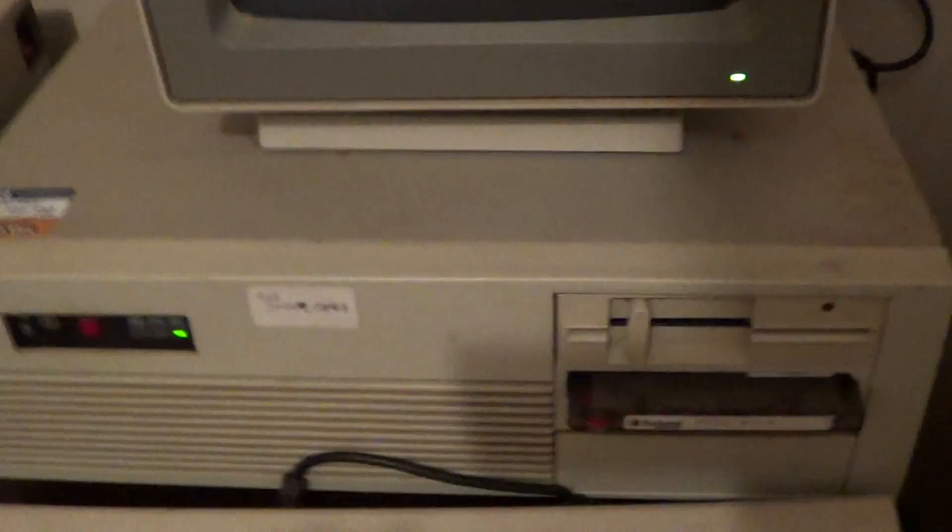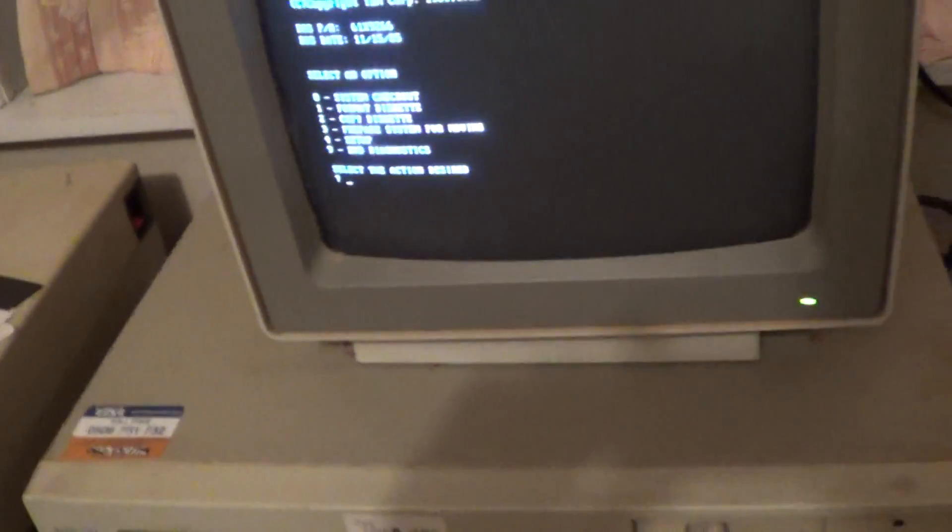There are the little lights — the turbo one is a bit irrelevant. The other thing I found when I built it was that the power connections on the motherboard that run those LEDs, for some reason on my board, are only producing about one and a half volts, and the lights wouldn't light up. The hard drive light runs off the controller and it's fine. But the power light I actually had to wire into one of the five-volt connectors on the power supply and solder a resistor in line. So there's a lot of work that's gone into this beast.